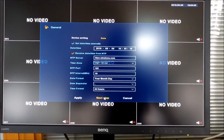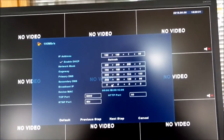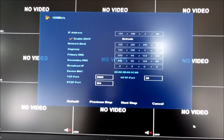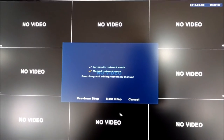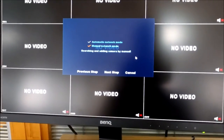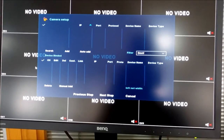Hit Apply and go to the next step. It won't be on DHCP to begin with, so it will have a static IP address. I'd recommend setting it to DHCP mode unless you really know what you're doing with IP addresses — just tick the DHCP box, then proceed to the next step. The recorder will then get its own IP address directly from your broadband router or DHCP server. For the camera network mode, leave it on manual so you can add cameras in yourself.